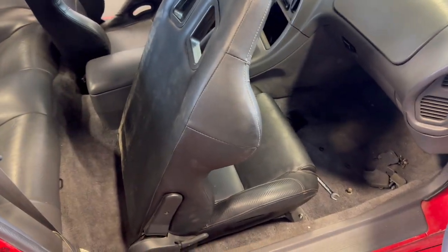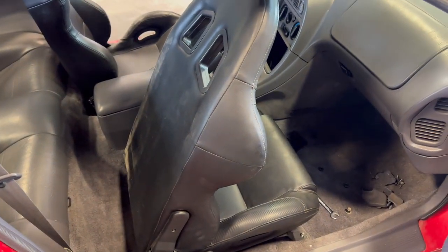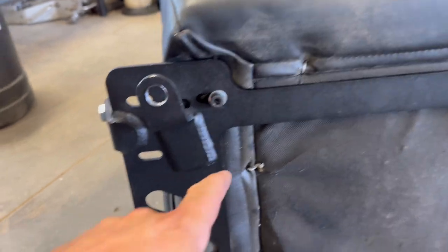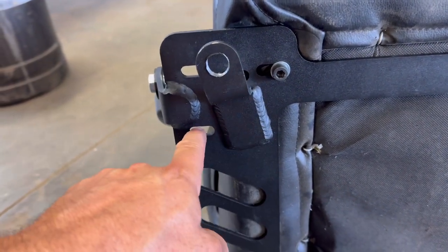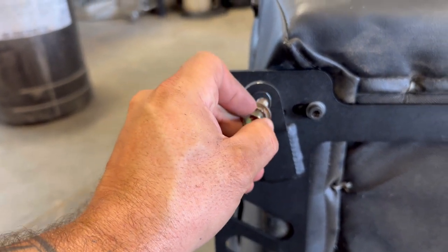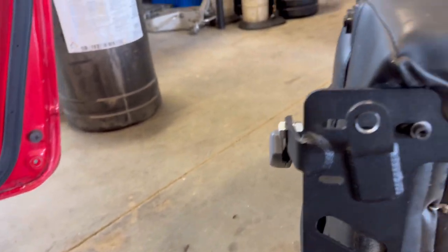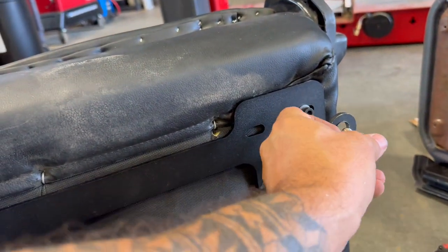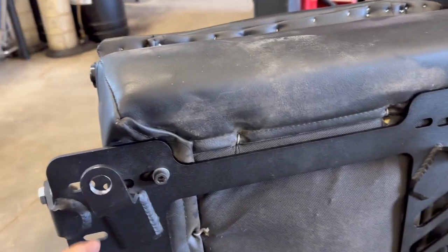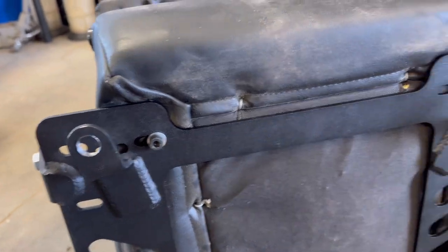They're not cheap, so it's kind of a disappointment. The welds look good, the fabrication looks good, but three quarters of an inch is huge. It's frustrating, but I'll get it in here. To give you an idea of how much I've had to ream these holes — the welding and laser or plasma cutting looks good — but this bolt here, that gap is significant. I don't want to go any bigger; it'll make it weak. I've had to do them all with a die grinder, but that's as big as I want to go.